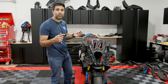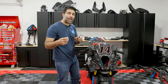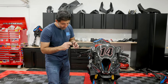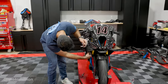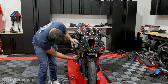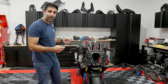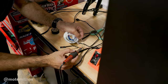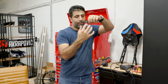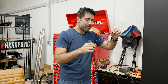No error codes — which means we don't need a resistor on these. I just have to wire them up. They come with quick connectors, but I prefer to use a soldering iron and solder them up nicely. I need to figure out the lengths; it sits right here so we have to run the wiring to this location. Trust me, it's bright enough that you'll clearly be able to tell the bike is signaling left or right. Once we have both sides done, we'll put everything back on the bike. It's all shrink-wrapped now — I'll add a bit of electrical tape over it and then this side is ready to install.